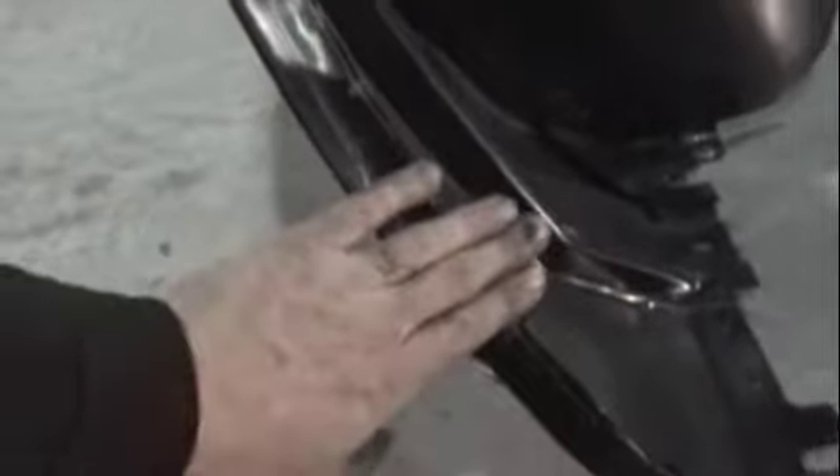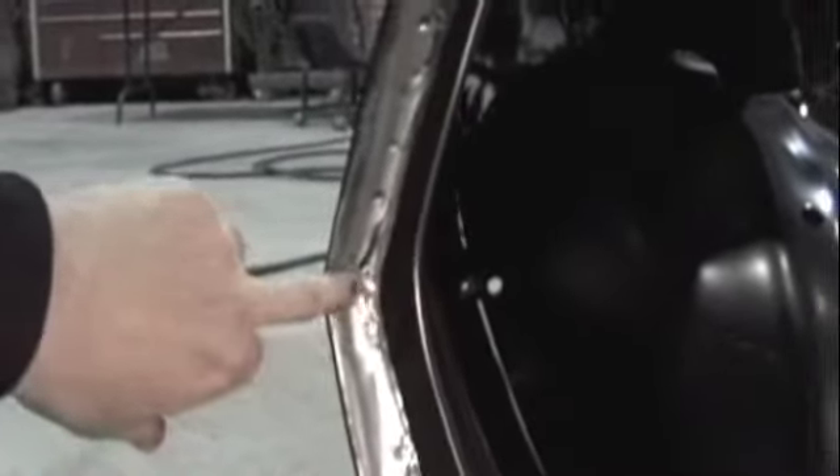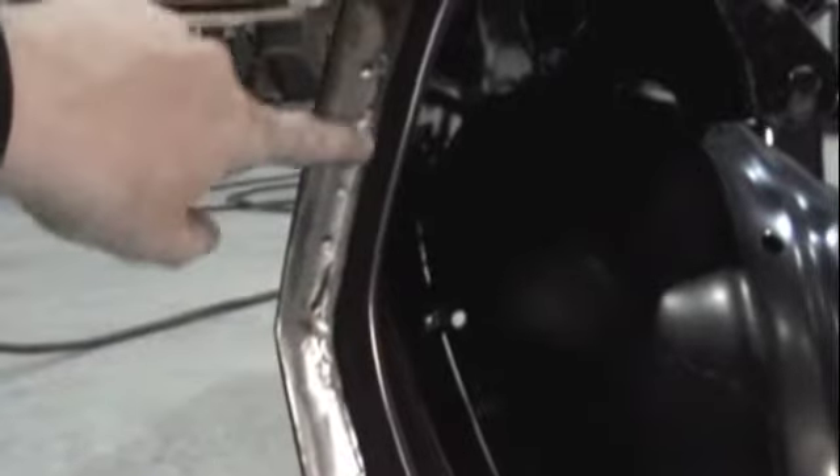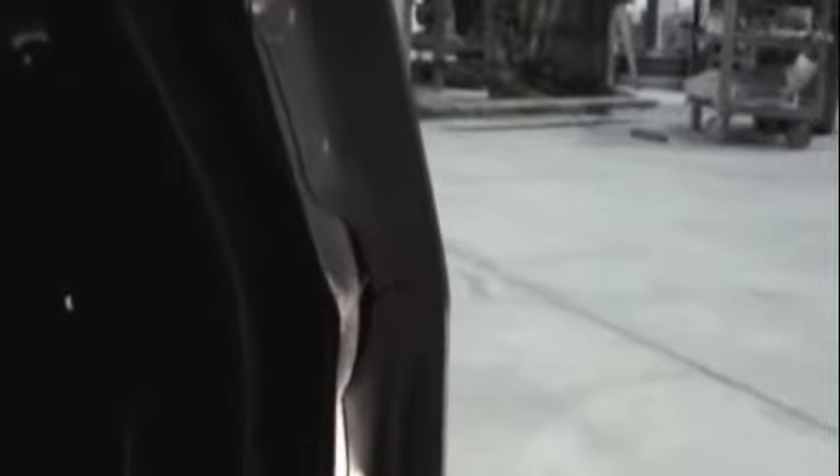You don't have to do the bottom of the door that much. The bottom edge was touching — flange that in — but you don't have to do this area as much, it's kind of folded and pulls away when the door is opening. The top pitches in, so this was the same way — it was touching right through here and all through here on the inside when you get the correct gap. Come back to this other one and see what I was talking about with the outside edge.